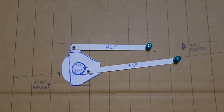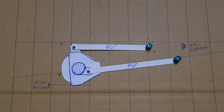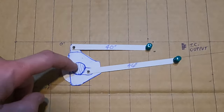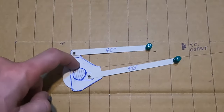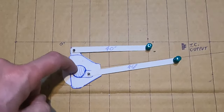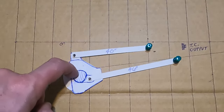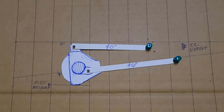I ended up putting adjustable mounting brackets at the chassis so I could adjust the angle a little bit. I ended up lowering my upper link at the chassis and it seemed to help traction a little bit. As you saw last time, the pinion stayed fairly the same throughout the travel — watch this one. Pinion's pointing at the transfer case output, dropped a little through extreme down travel, but the main travel range you're concerned about it points at the transfer case output much better with the upper link parallel with the ground.